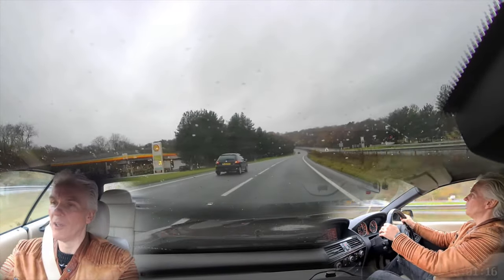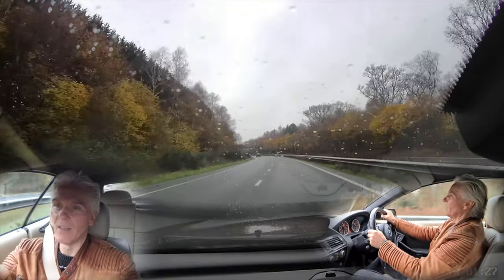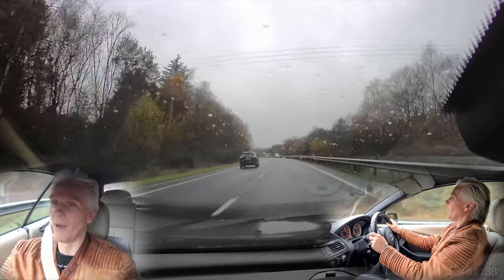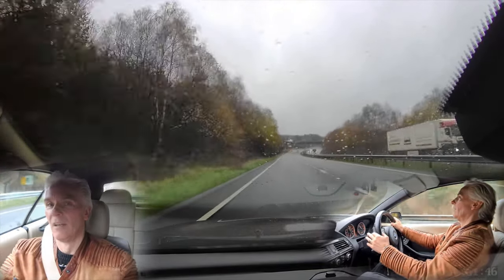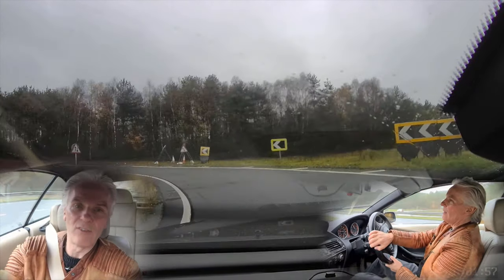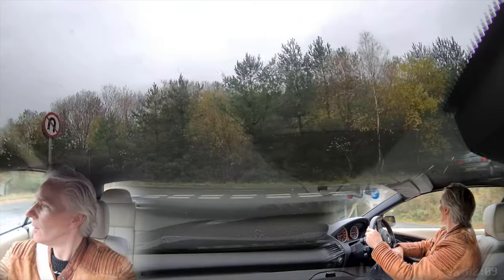Sports mode makes you look a complete idiot, especially since these N62 engines just love to rattle the valves around on the overrun. You finish accelerating, lift off the throttle, it stays up at about 5,000 RPM and rattles the valves away — they all do it, don't worry, it's perfectly normal. In steptronic mode, down a gear, down another — that's third. Much better control over the car using engine braking around the corner. The DSC has noticed spirited driving and has stiffened up the suspension quite a bit.